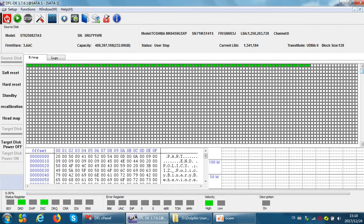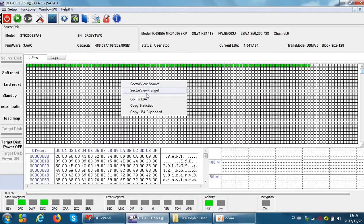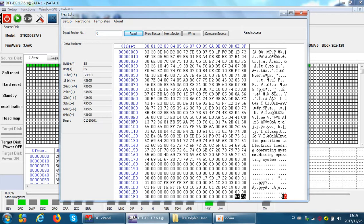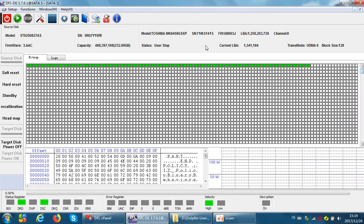Now we can power off the target drive, then power it back on. The target drive can then be used perfectly as a boot drive with the computer. It is very important for users to remember that after the image or clone, it is a must to change the target drive's sector 0 end characters from 55BB to 55AA. This is the only additional step users need to perform to complete the data clone.